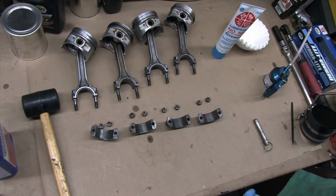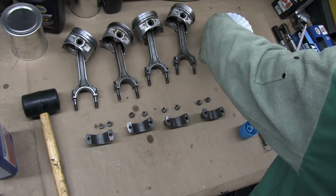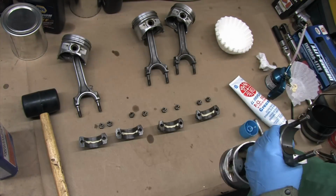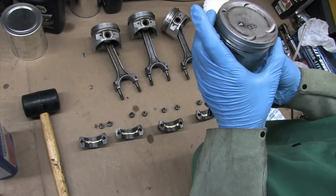Look, there's 4 rod caps smiling at you. I think they like their new bearings. Put a 3/16 inch to a 1/4 inch bead of assembly lube on all of your rod caps so that they're ready to go. Once you start this, you're rolling. Don't leave them sitting around. Blow any foreign material off the rod bearing surfaces, check the ring clock, and then make sure nothing's shifted.